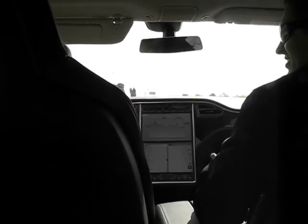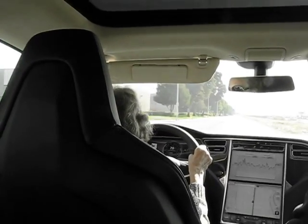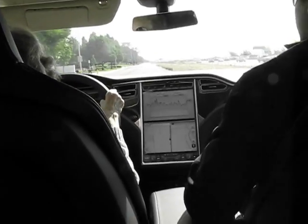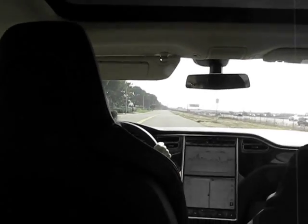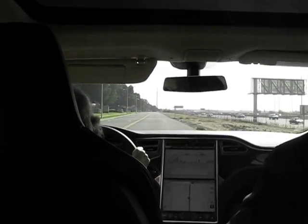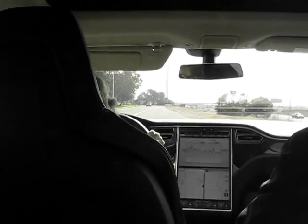Can you feel how smooth that is? Yes — I've been going 71. Look at the energy usage measured in kilowatts. As you lift the pedal, that will dip down into green, and that's what's charging the battery as well. You can recover a maximum of 60 kilowatts — say if you're braking at that level for a minute, you get about an 80th or so of the battery back. You're not getting a ton of power back but it does help. More so than that, it really just saves your brakes — you won't replace brake pads for a long time.